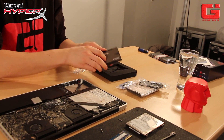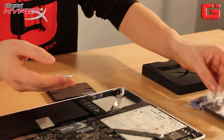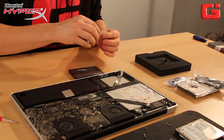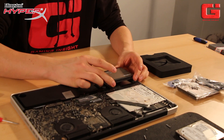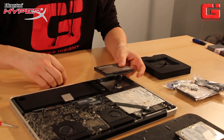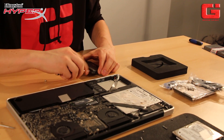Now the new SSD. Go and grab it, and grab the fitting screws. Please take the small ones on the left side of your screen — we will need two of them. Open the package, remove two of them, and set the rest aside. Take the SSD and check how it will be installed, because you need to have the data cable plug on the right side, and you have to check for the right holes to fit the screws. We will need those two holes in the direction of the MacBook. Now screw in both screws, but not completely — let them stick out about 1 to 2 mm.